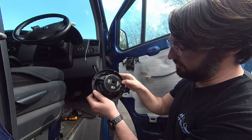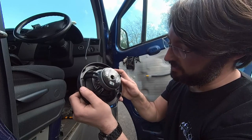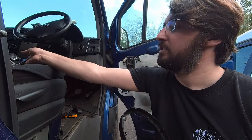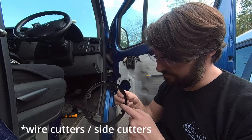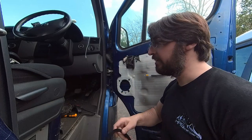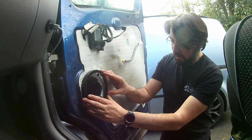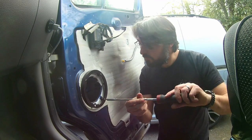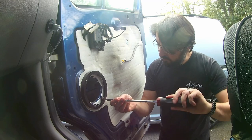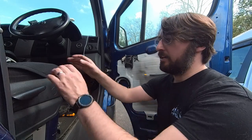I've made the adjustment. I determined that because the mounting holes on the spacer ring aren't equally spaced, one of them was interfering with the support bracket. I've used a pair of pliers and wire cutters to cut that off - the plastic was soft enough that it went through easily - and then I filed it to make it smooth. I'll remount this and then get the speaker in. Speaker spacer rings are back on.